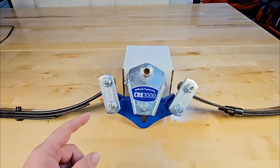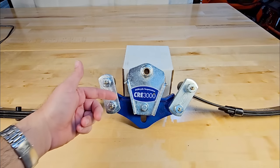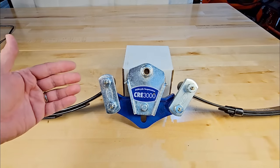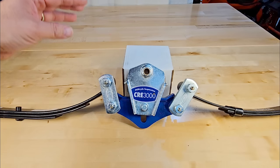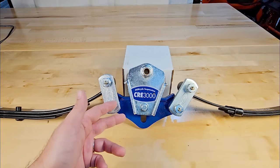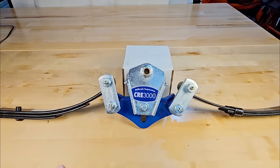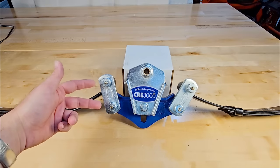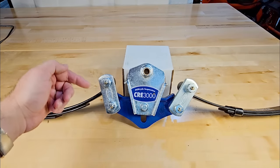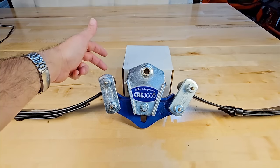This is upgraded because it helps mitigate, through a rubber bushing, the shock, vibration, and harshness that would normally transmit from the road to the chassis of the RV, reducing a tremendous amount of that shock. It also features heavy-duty shackle straps that are half-inch thick and greasable wet bolts that you can put grease into, squeezing it into the bronze bushings inside the leaf springs.